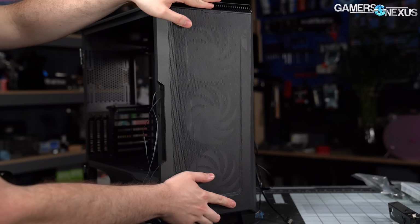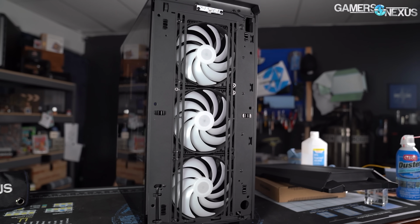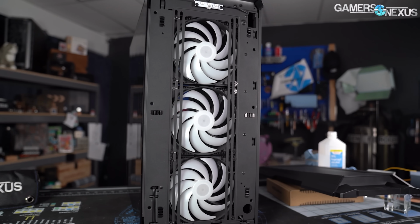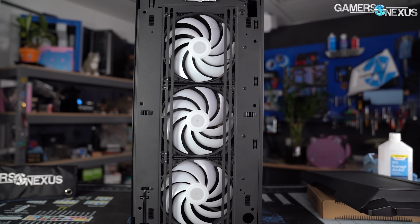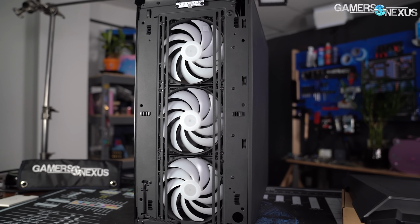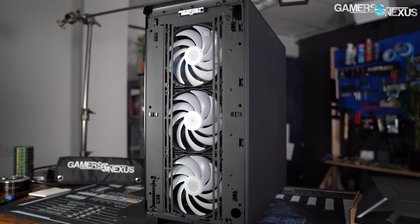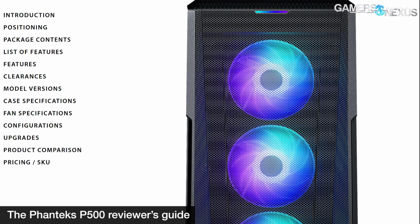They just don't fit. The panel is just deep enough to fit standard 25mm thick case fans at the top and widens toward the bottom, so there are no issues there. But the usable area for the fans inside of the panel is only about 37.5 centimeters tall. This is about 3.5 centimeters shy of the height of all three fans stacked on top of each other.